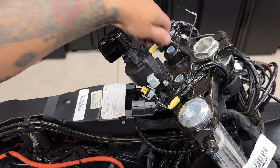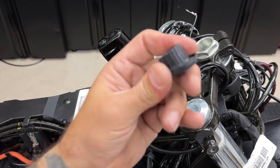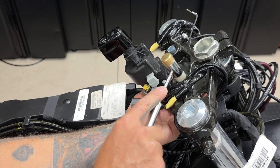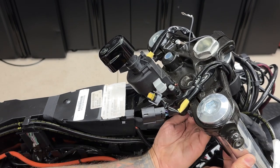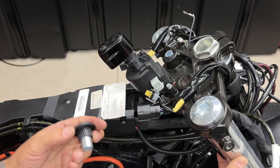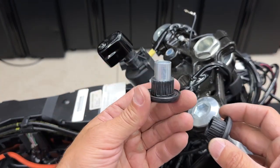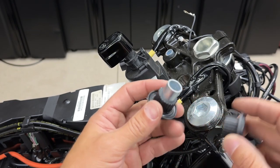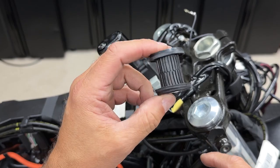It's going to work and last a lot longer. So you can take out the rubber bushings from the bottom the same way you took out the top, and that spacer will come out. Or you can just use a rubber mallet and knock it down and they'll both come out from the bottom. So inside of here, they just sit just like this. This is your bottom piece with your spacer. And then here's your top bushing, and it sits in there just like this.